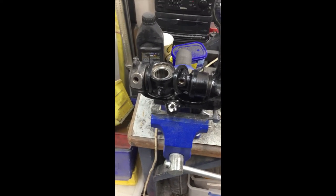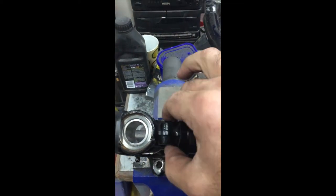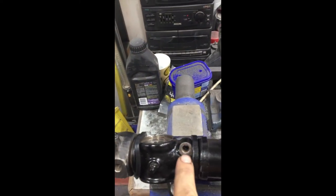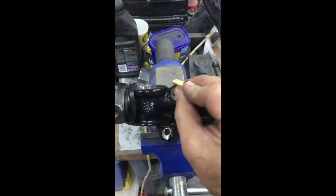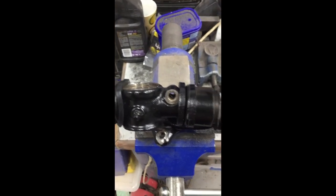I have whacked it back in the vice, and before anyone freaks out - I do have tape on the shaft so I'm not marring up that with the teeth. You can see it moves nice and smooth. We've still got these little seals - one that's got to go over the top of that, that one's got to go over the top of that. You don't have one down at the bottom. You can see that it's moving quite freely. Now we can't use the original bolt that ran through here because that will get in the way. You just need to get yourself a high tensile - and it has to be high tensile, don't go putting a dodgy one in there. It'll have 8.8 marked on the tip of it.